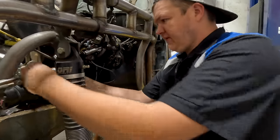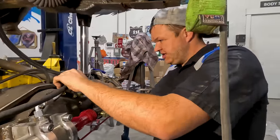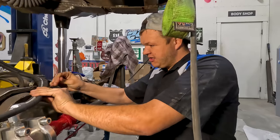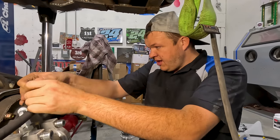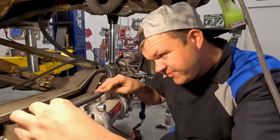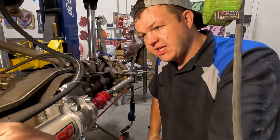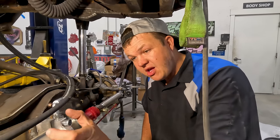All right, I'm gonna have to hurry and figure these out real quick, and then I'll show you. I was almost perfect, but not quite. So we've got one hose that's clocked correctly. I tried to clock them at the tractor store. Thought I clocked them correctly. I've got one. This is what's so nice about mobile hose making. So you can see that one's just a little bit too long and I've got it clocked wrong. What I'm gonna do is I'm gonna actually cut this end off, put it on, get my length correct, and clock it and mark it.